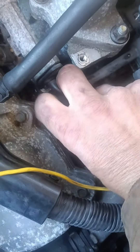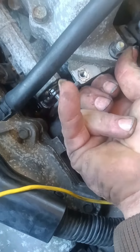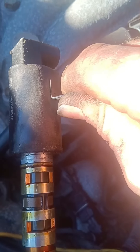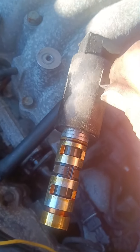When you break your fuel rail loose, it's going to be under pressure, so watch your eyes. I've already broken it loose, so it didn't spray me in the face. And look what room you've got to pull it out — that's it. Turned an hour-and-a-half job into about 10 minutes.